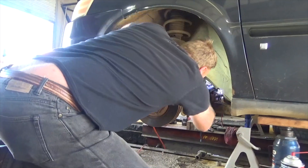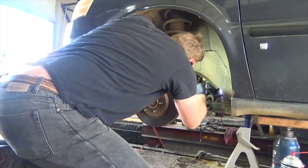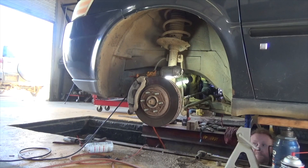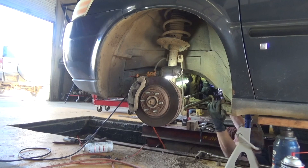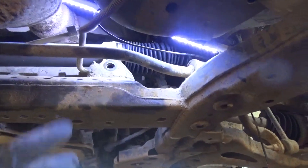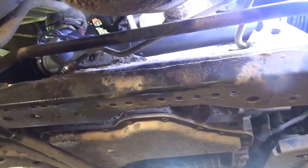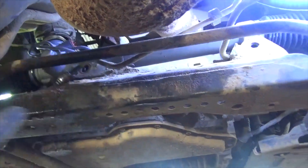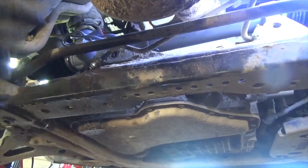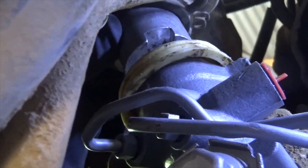Remove and install it from the driver's side wheel well. When removing and installing the rack, the passenger side mount has a plate in front, so you have to wiggle the rack a little more to the passenger side and push it up and down to get it to fall into that mount. Now we need to get the holes to line up — slide the bolts back in, which means we have to kind of pull down on the sway bar. Down and in place.